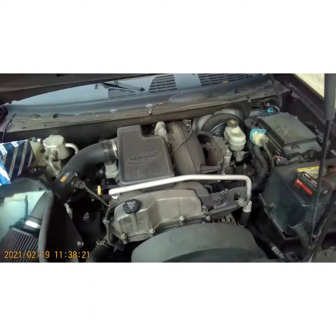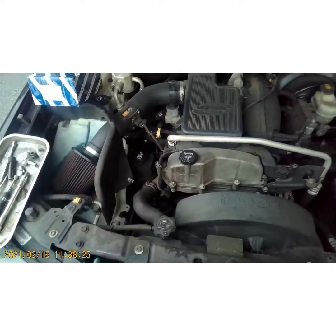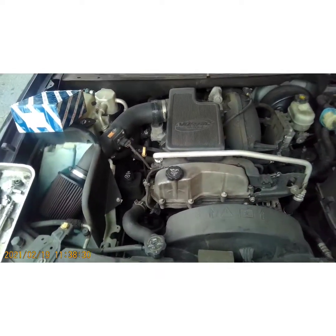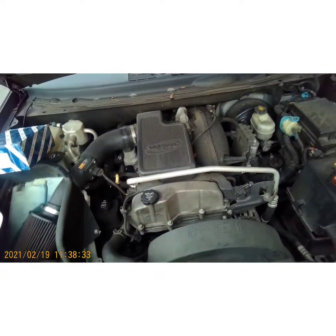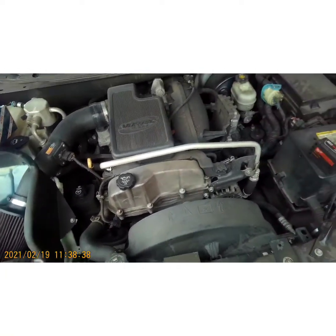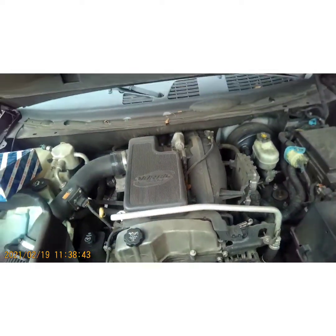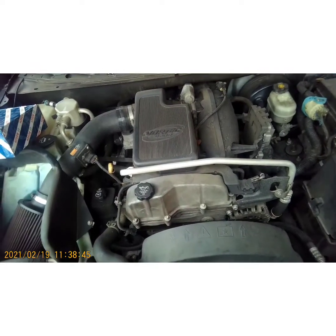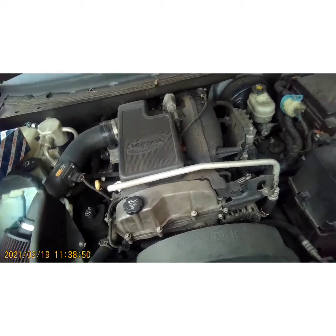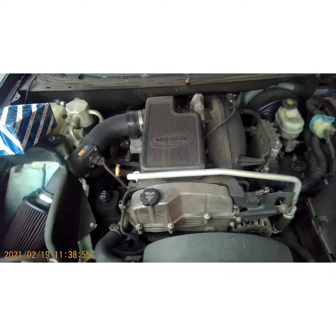What's up YouTube, today I got this 2008 Chevrolet Trailblazer and the customer's complaining of reduced engine power and the check engine light coming on and off. I've already scanned this — it's got a P0121, which is TPS sensor throttle body performance. This is a notorious problem on these Trailblazers and really any GM that uses this style of electric throttle body. I already took the boot off and cleaned the throttle body because a dirty throttle body can cause that too, but that didn't fix it. No need for further testing — this is such a common problem, I'm gonna show you how to replace it.